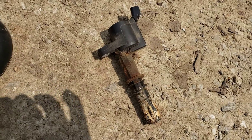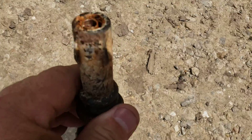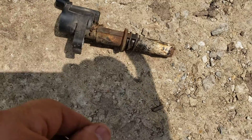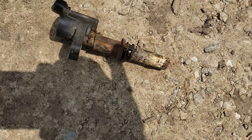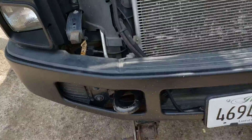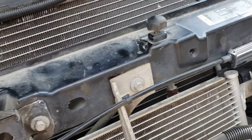This is the coil that came out of one of the cylinders and you can see it's all corroded and wet inside — not a good situation. Also on that one, when I took it out and went to put the new one back in, it was having difficulty going in, so I took some high pressure air and blew out the cylinder with the spark plug still in there, and that seemed to clean up things nicely.